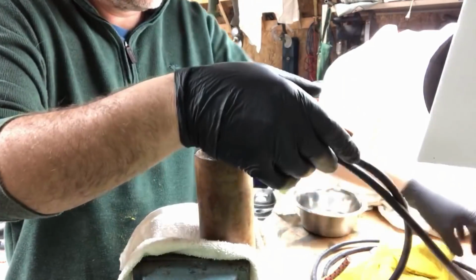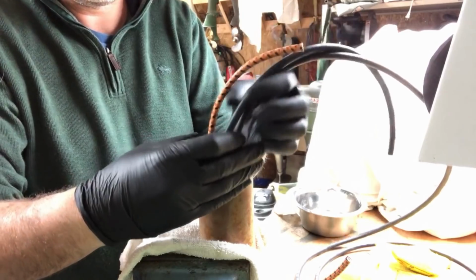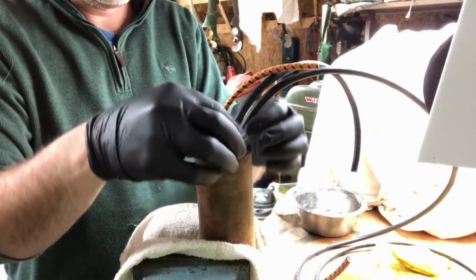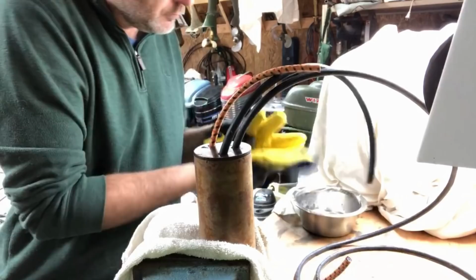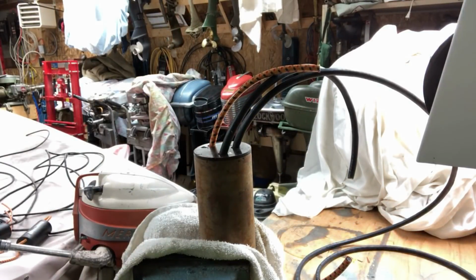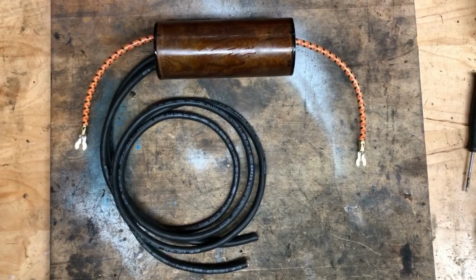and then reposition the end cap. Be very careful to make sure that you keep the spark plug wires indexed to each other. Otherwise, the spark plug wires will be in odd positions to each other. Once the wax is cooled, this can't be corrected. You would have to melt the wax and start again. And that's it. Just connect your favorite spark plug terminals and you're ready to install it on your motor.